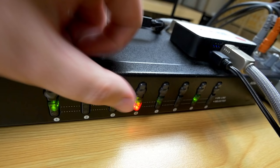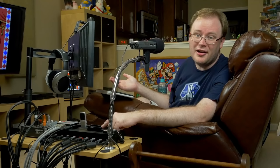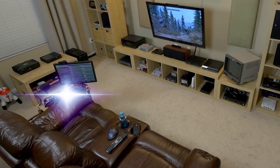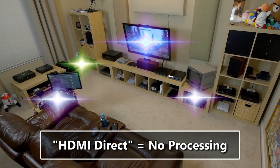The reason I have this set up next to my couch for manual switching is because Monoprice's HDMI switchers use the same infrared signal as the Framemeister, meaning that if I switch inputs with the remote, I'm probably also changing some unknown setting on the Framemeister, and yeah, that's bad. The HDMI switcher's output goes to a splitter that sends the signal to the TV and Framemeister. I pass the HD systems through the Framemeister just for the convenience of capture. It's set to not process HDMI inputs.